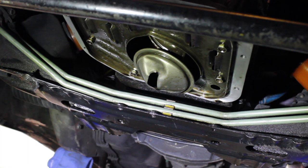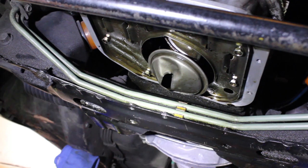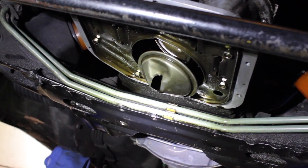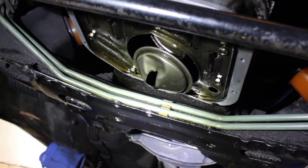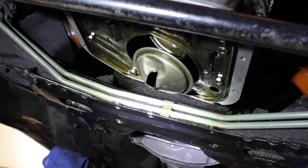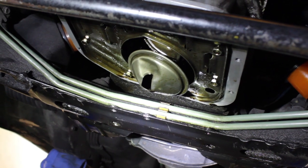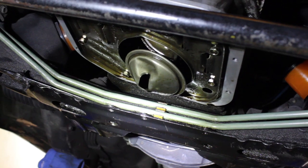So we are at a standstill now. I don't want to put the oil pan back on, knowing that it has a dented up oil pickup. So I'm gonna go ahead and order the oil pickup, and I guess it's a good time to upgrade because this is the older model red top. It has that janky oil strainer that usually falls off if you hit a bump or you dent up your oil pan, and just sits at the bottom of the oil pan. So I'm glad I caught it now, rather than later, or potentially blowing up my engine because I don't have any oil running through the system.